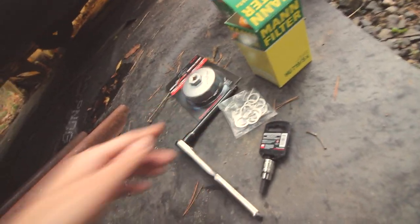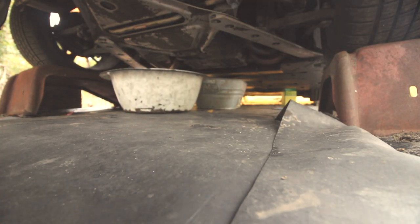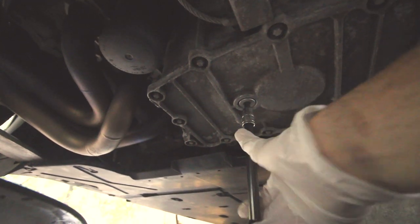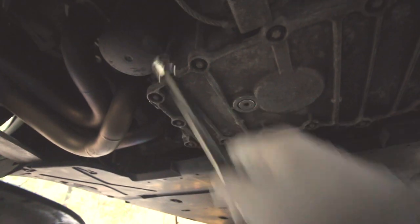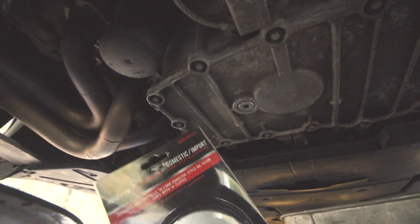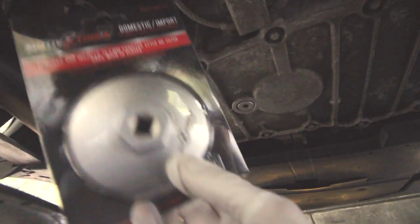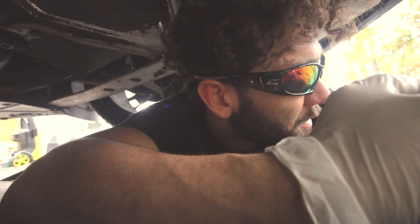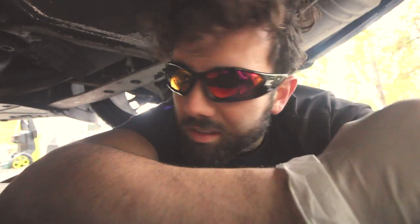Now that we are under the car, that right there is the drain plug — you can confirm it by fitting the socket in there. And that is the oil filter canister. This is a 74.2 millimeter canister-style oil filter cap removal tool. One tip I want to throw out: have your hatch popped prior to doing all this — less chance of getting things dirty. Even with gloves on, I like to pre-expose the areas I'm going to be touching so I can put fingers in fewer places.